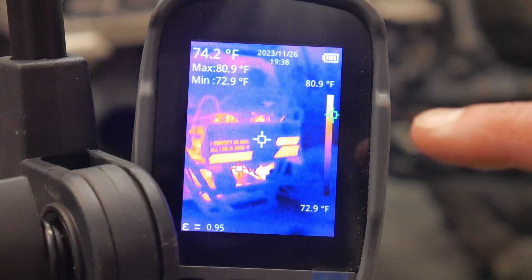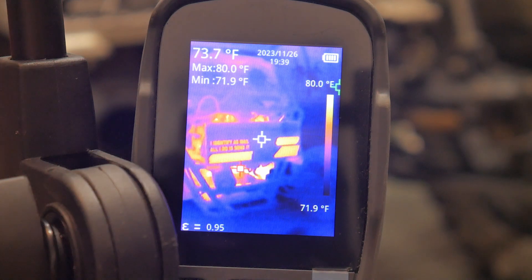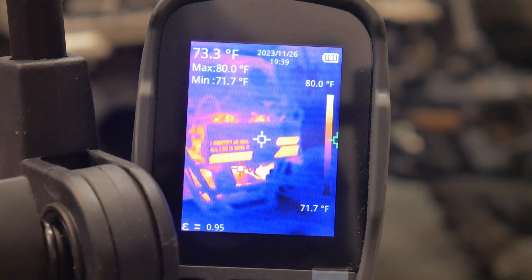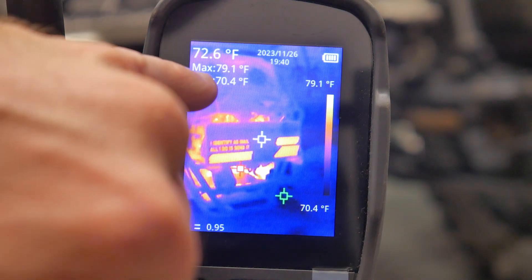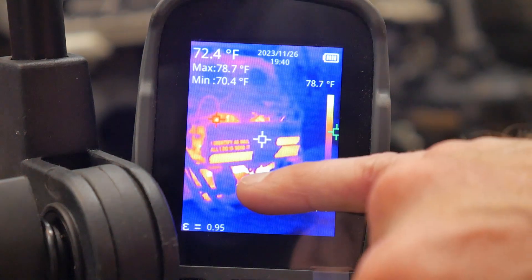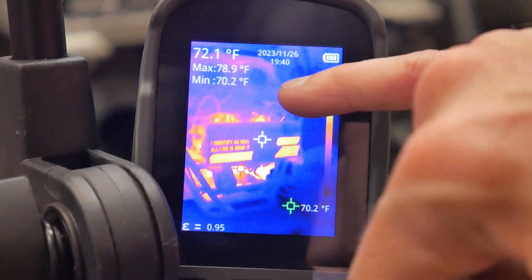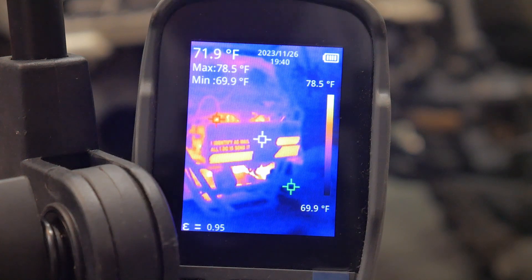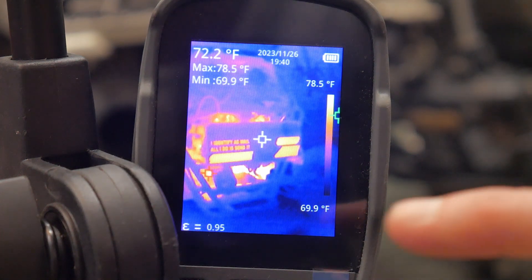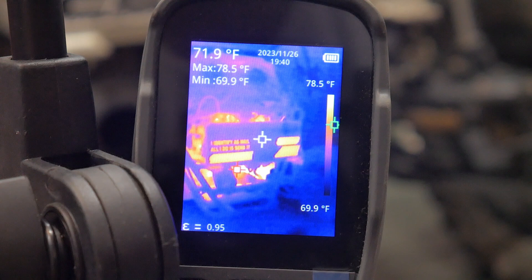At this point the engine has been sitting for about six hours. For some reason the stickers are showing a few degrees warmer and I don't know why that is. The radiator is completely cold. Our max temperature is now down to 78 degrees — even areas underneath the buggy are only at 78 degrees. I think that's close enough not to skew our final results, because this machine was running for a solid hour with a very hot exhaust and turbo. I'll run two cycles to put us at one hour of run time and then take temperatures.